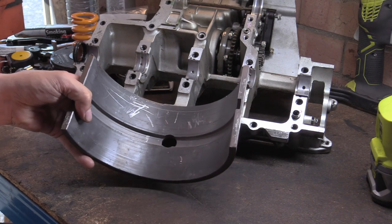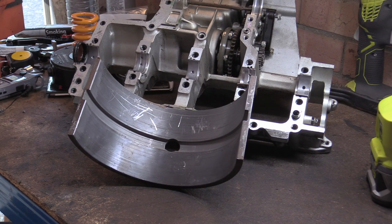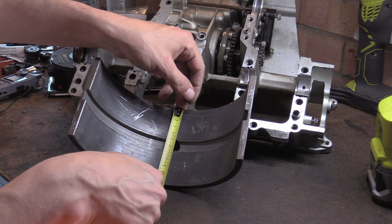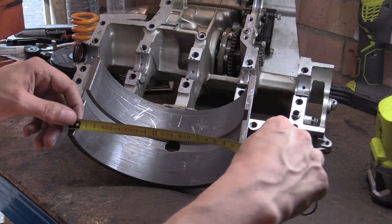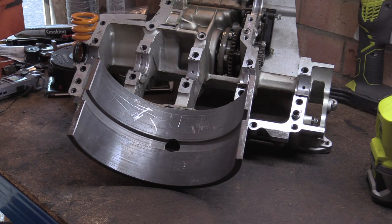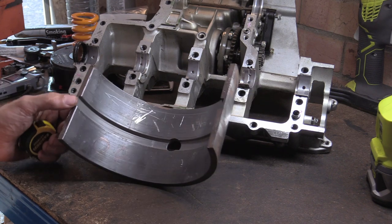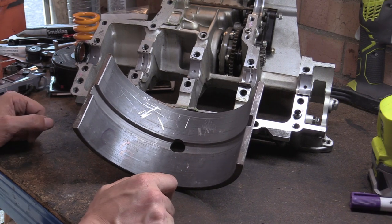These are oil-fed, pressurised oil-fed systems. The bearing is really there for start-up and to maintain the oil pressure at the bearing. If we get a tape measure out, the LD Ratio is the length of the bearing. This is 115mm by 190mm across. 115 divided by 190 equals 0.6, which is quite high already. So the LD Ratio, the Aspect Ratio of this bearing, is nominally 0.6.